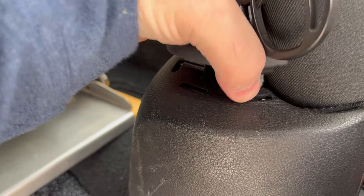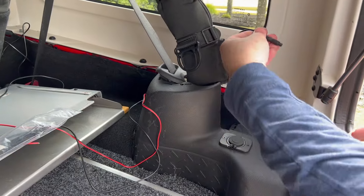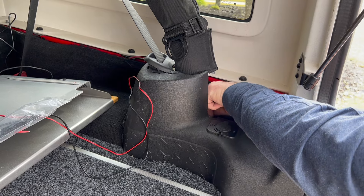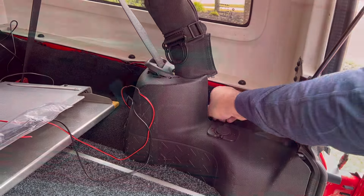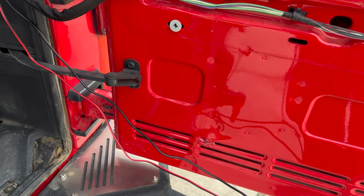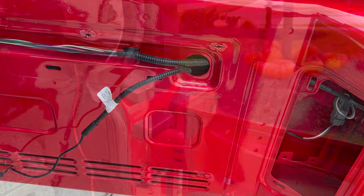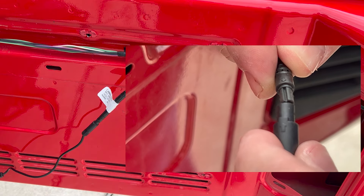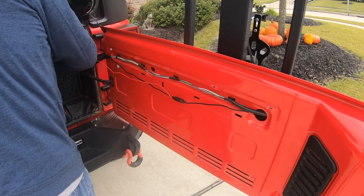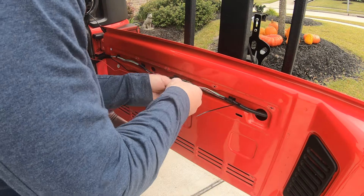The molding can be easily disassembled by hand. The next step is to run the wiring harness through the back molding towards the tailgate. After running the camera wire through the back tailgate through the tailgate vent — not shown — connect the camera wire to the harness. Make sure the two arrows are aligned. Using the provided zip ties, secure the camera wiring harness to the factory wiring.